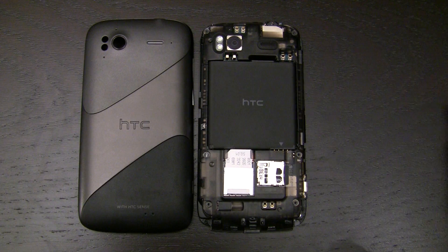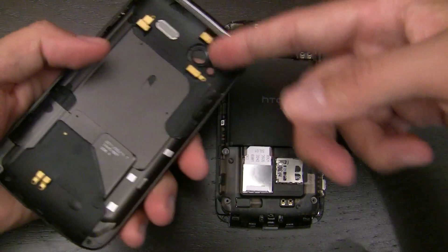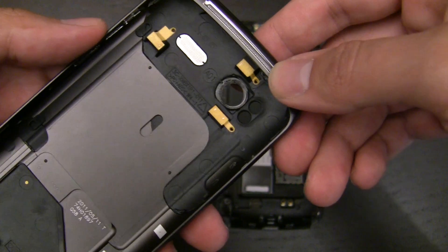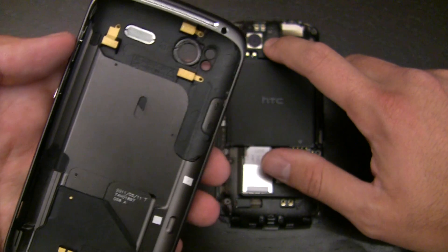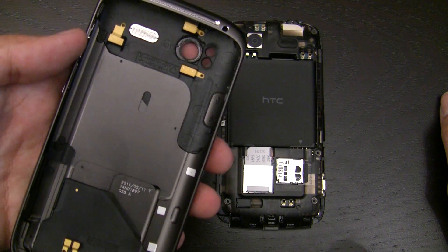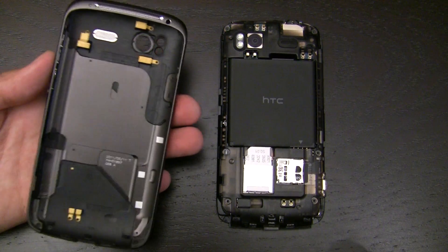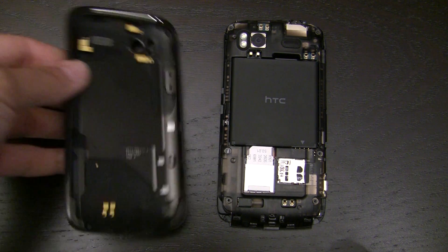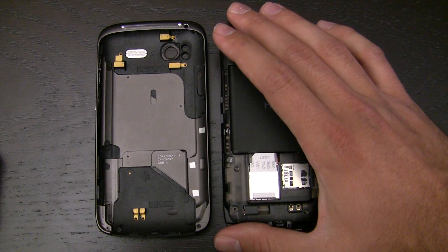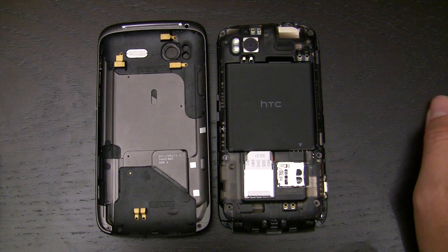One of the nice things about the Sensation is that the camera module doesn't have a piece of plastic in front of it. There's a little rubber or foam seal so you don't get dirt inside from the camera, because that's really the largest hole other than the LED flashes. As a result, there's no other optical element in front, so when you stick this thing back together, this really is the first surface of the camera. There's no longer a place for dirt to get in — that was a big complaint with the Nexus One, where a fingerprint on the inside would always add glare and scatter. But that's fixed now.